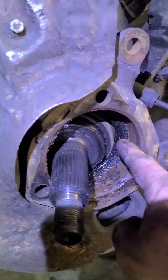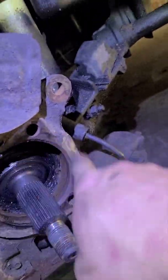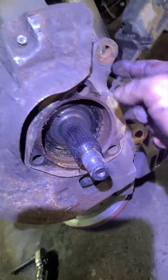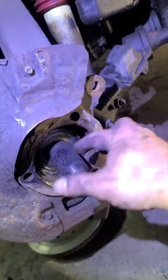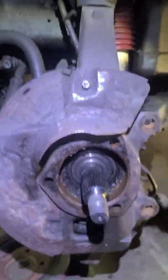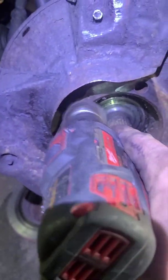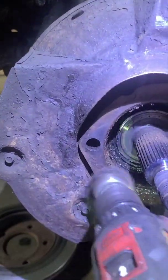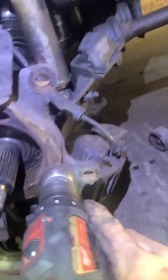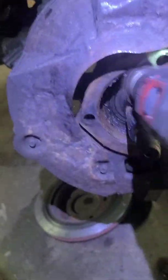See how all the grease came out of the wheel bearing? What I like to do is clean this up, straighten out the steering knuckle so it goes on flat and straight, get everything lined up. Then I'll put my bolts in by hand on the back, put a little grease here, and hit it with some brake clean. Coming in with a wire wheel, I like to clean off this surface — if you want the wheel bearing to seat flat, the surface needs to be clean.